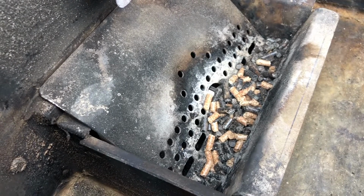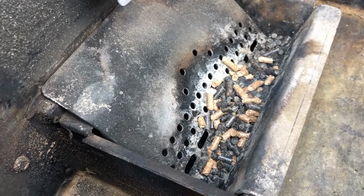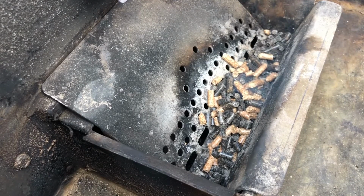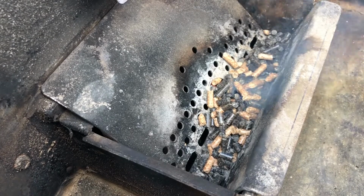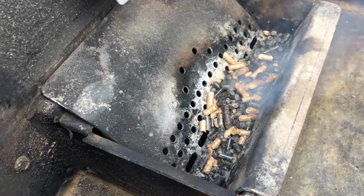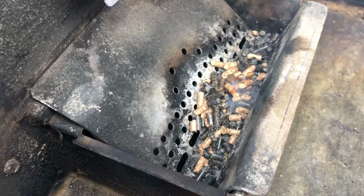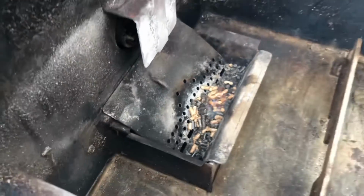Oh yeah, I can see it glowing down there, and we've got a little bit of smoke. Okay, so 1 minute, 19 seconds, we've got smoke here for sure. All right, y'all can see that burning through there. I haven't really watched this much without my plate on, but I can tell you right now, yeah, we've got fire. So this is when I would normally shut my pit down. And yeah, there's a flame. So at 1 minute and 40 seconds, we 100% had a flame going here on the new ceramic igniter on the Y640 Yoder smoker.